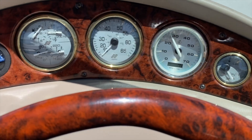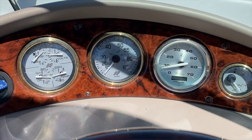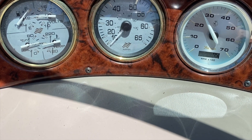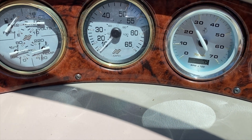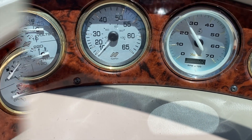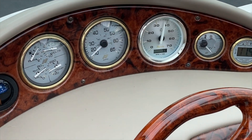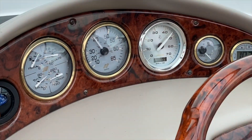Here's the before: we could only get up to 2600-2800 RPM and then it would just quit — could never get on plane. In neutral we could rev it as high as we wanted, but it didn't have the power to get up on plane. This was taking it out of storage for the first time this year. At the boat launch on initial startup there was a bunch of white smoke, got up on plane going across the lake, shut down to coast in, powered up again, and would not go over 2800 RPM. After installing the cleaned injectors, we're already past 3000 with noticeable acceleration and higher RPMs. We got it all the way up to 4800-4900 RPM and 45 miles per hour — a big difference from before.